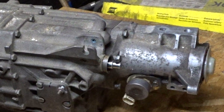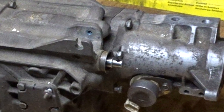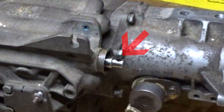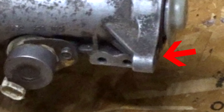Removing the gear shift assembly is very easy and I'll explain it in a few words. Shift it into first gear, remove the cable ties, slide the snap ring on the gear shift rod past the shaft pin, and take a drift and punch out the pin. Shift back to neutral and remove the control arm bolt up front and the two bracket bolts in the back. That's it.